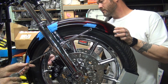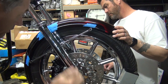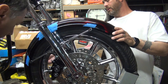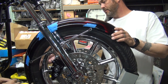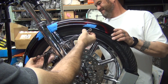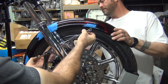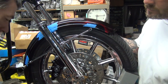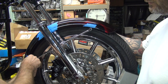One hole lined up perfectly but the other is off a little. They get one bolt in and move to the other side. The fender is finished way over to one side — they've got a lot of gap on one side and none on the other. The holes control the height and pitch. They need to bend one bracket down a quarter inch. They take turns bending their respective brackets down, getting gap on each side, then rotating the fender to try to get it more even.